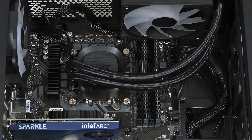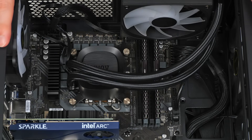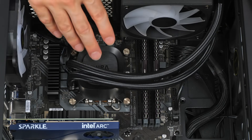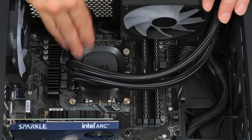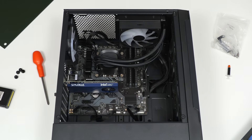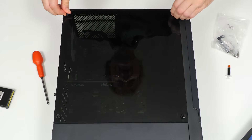Using the magic of filmmaking, the pump and fan headers are now connected and all the wiring is in place. The pump power supply — the CPU fan header — was tricky to get in but it's now in, looped around to be neat, and I've even put on the back side panel. The final thing: there's a logo on top of the cooler which will light up, but it's currently upside down. This can be rotated to the right orientation. Having checked very carefully for leaks, let's replace the glass panel and prepare for some tests.